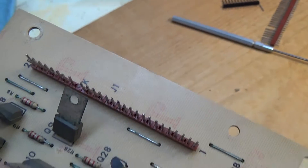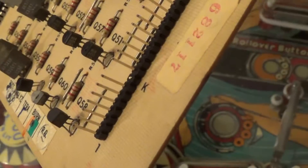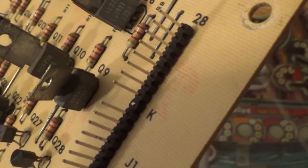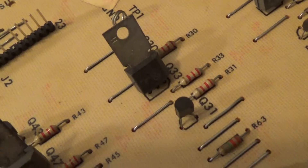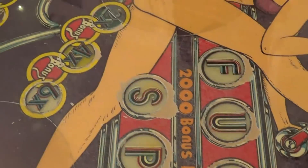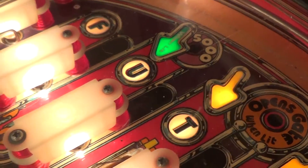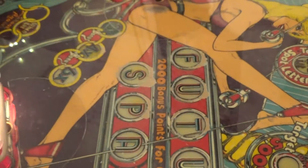Looks pretty nice. So I'll just have to do this three more times, then we'll plug it into the board. We got all our beautiful pins in and the keys all cut out. So let's stick it in the machine and see how it plays. The connectors went in really nicely. We'll turn it on and give it a second to boot up. And there you go — look at that. The U is back, the S is back, the 2X is back, you got the 2000. Very nice. And finally the U. So there you go — it seems to work, just by changing out those connectors.